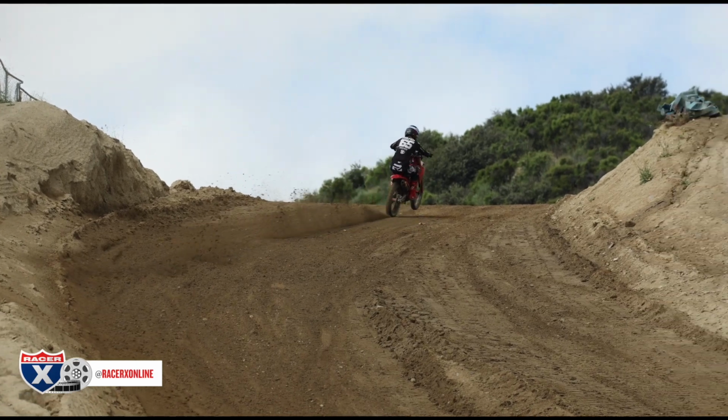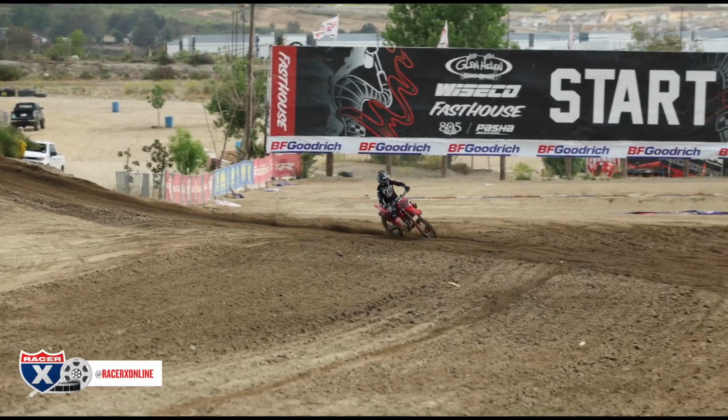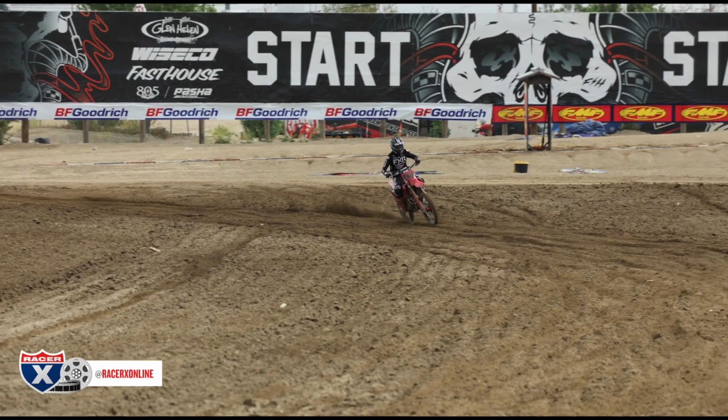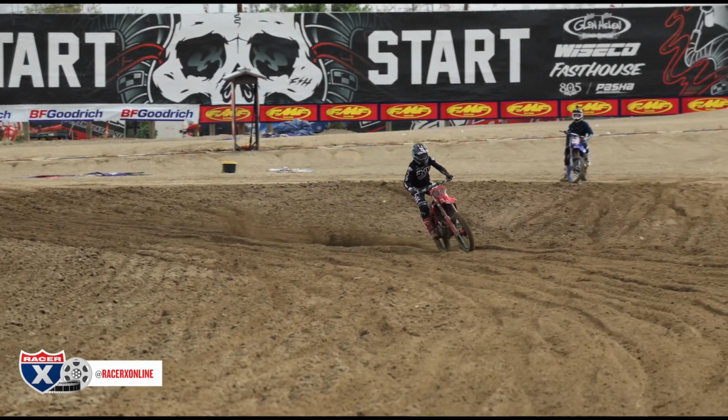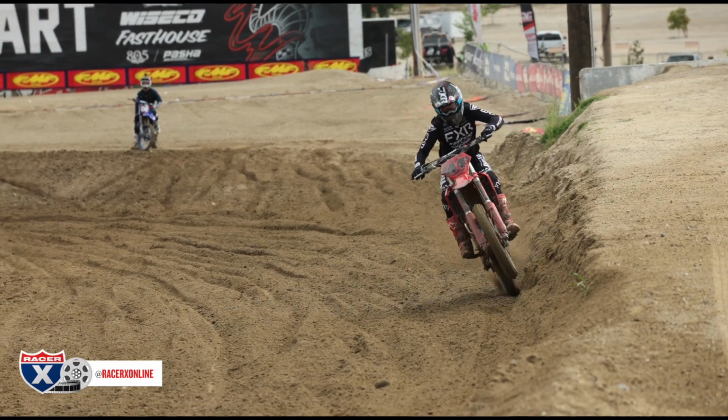So as you accelerate, I want a little bit of power. I want to be able to shift into third and get that power down to the ground and get up these hills at Glen Helen Raceway. This Vortex ECU, mated to this FMF slip-on exhaust, really does help that for you MC 250 owners out there. Now I will say the insert is in. I prefer the insert in, kind of like what Jay said. They cut the screen out, put that insert back in, and that gives you some more back pressure, gives you some more RPM response, which this bike needs.